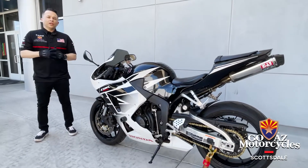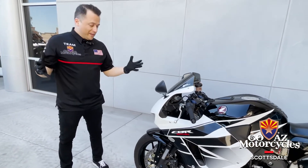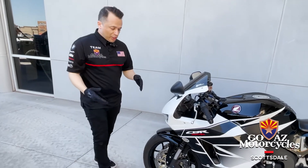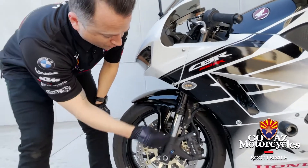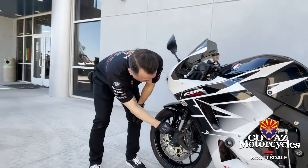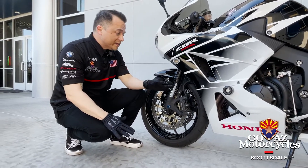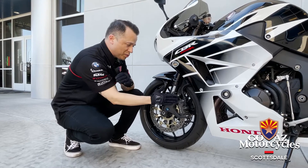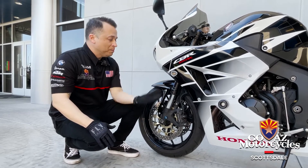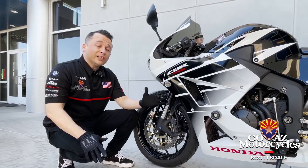We're gonna do a quick visual inspection of our suspension — it's a really important piece of the motorcycle. We're gonna check our forks and make sure these fork slider tubes are nice and dry. Both look really good. If we notice any pooling or moisture built up around our dust seal or down at the bottom, that may mean we have a leaky fork seal. This is bad — if it starts leaking while we're compressing, it starts putting oil back to our brakes and our brakes are gonna stop operating. It's also gonna prevent our compression and rebound damping from working correctly.